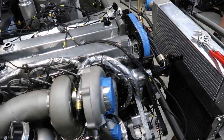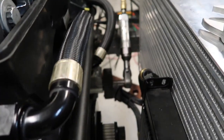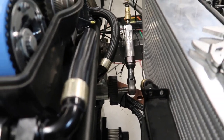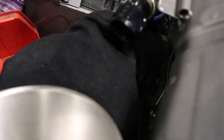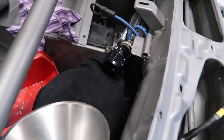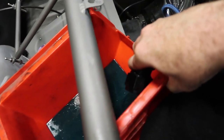Right now Shane is priming the oil system, which is pretty cool. It's easy to do with a dry sump — you can just put a ratchet on your oil pump without a belt on it, spin it, and you're pumping oil. We already backfilled it, and now we're going to run oil out of the return hose just to make sure it's flowing all the way through the system before we plug it all back in. And that's oil — we're juicing.